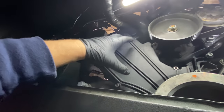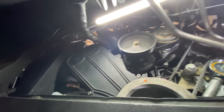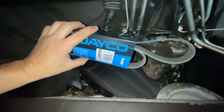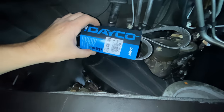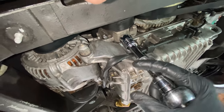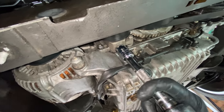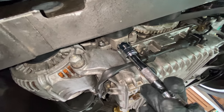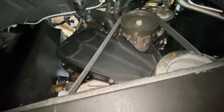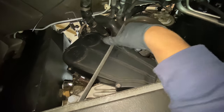All we've got to do now is put the car back together. Both covers are in place. I'm installing a fresh new alternator belt — the belt slips on nice and loose over the pulleys. On this tensioner we go the opposite way to tighten: what normally feels like loosening will actually tighten it up and put tension on the belt, and you can see it starting to get a bit more taut.